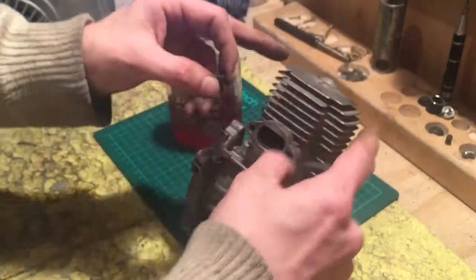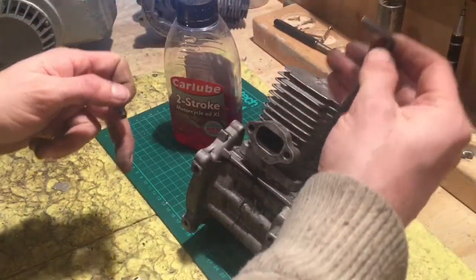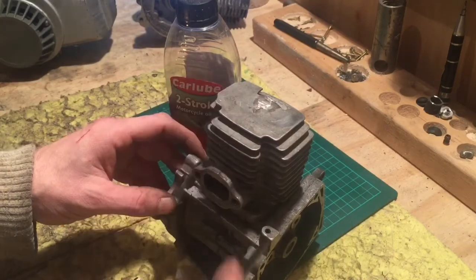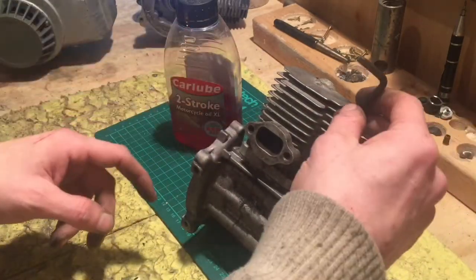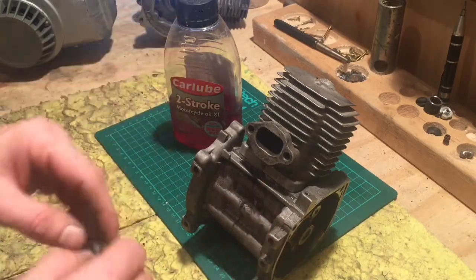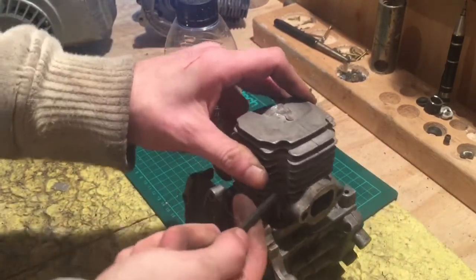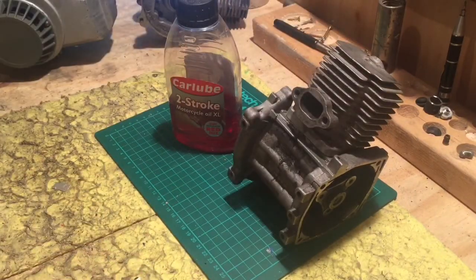Once it's back on — sometimes you wouldn't have these corners missing on your head, there would just be a complete square head, but there might be holes going down inside — that's how you would get to the bolts. Then you just start putting your bolts in and get them down to nearly bottom. You want to do that in a star pattern — start one corner, go to the opposite, take another, go to the opposite — just so it starts to get everything down equal. Once it's all nearly bottomed, lightly go until you feel a slight tug on each one. Most of these bolts would be tightened to a torque rating, but slightly over tight — not over tight, just slightly, perfectly tight — seems to work every time.